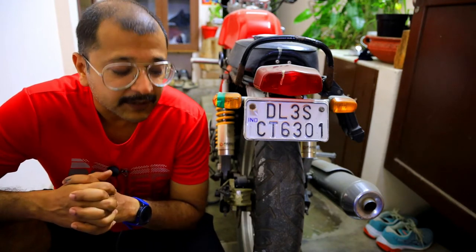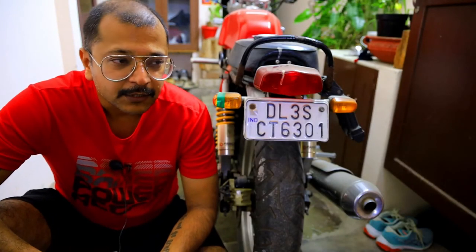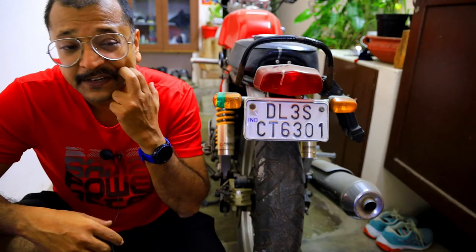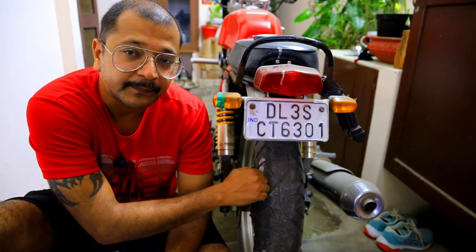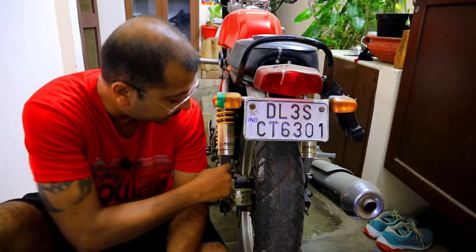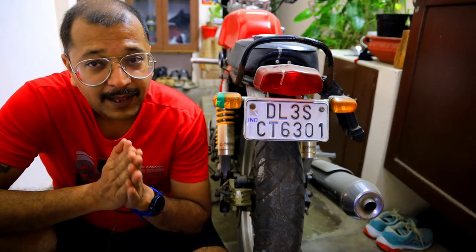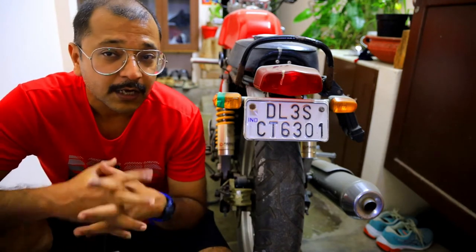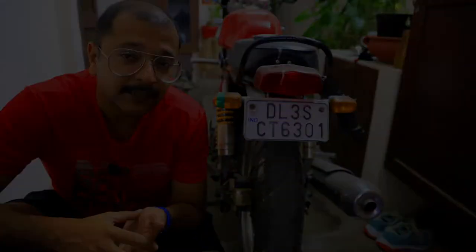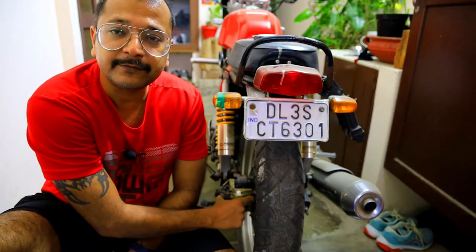In this case, let's start diagnosing it. He's already replaced the pads, so if the pads are new and the correct specification for the GT 535, then maybe you need to check the alignment of the wheel. The disc runs between the two pads, and if your wheel is misaligned, the disc is misaligned and it's going to touch against one side of the pads again and again, which could cause the wheel to turn tighter.